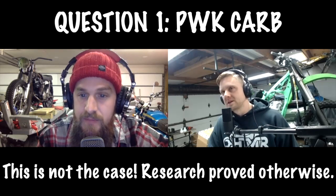So I ran into this because I was working on a Triumph that usually takes Amal carbs, but we put a Mikuni VM on here, and the needle holder looked like it was for a 2-stroke application, and I forget which way it's supposed to go. And also the top of the emulsion tube that sticks into the throat of the carburetor sometimes has a cover over it, like a half moon, you know what I'm talking about? Yes. Or sometimes they're flat, and it's to get a different fuel signal at low throttle. So yes, I think there's a difference. I don't know the answer.